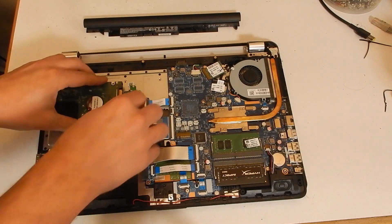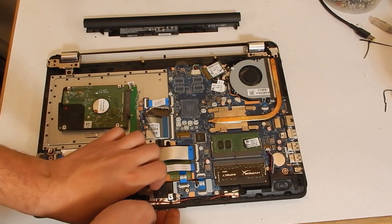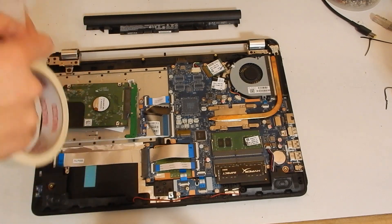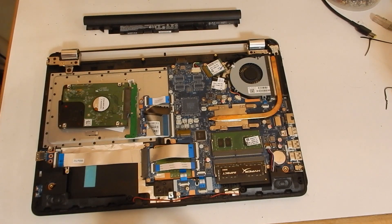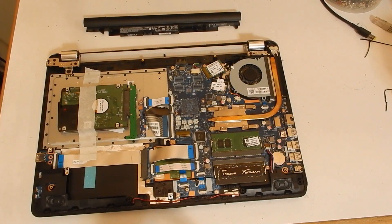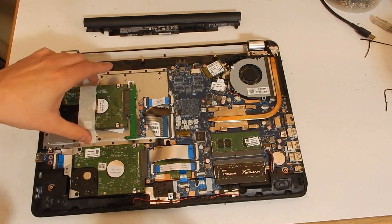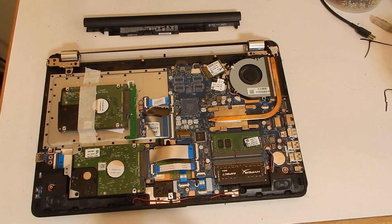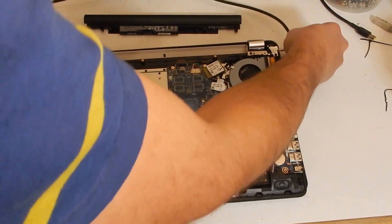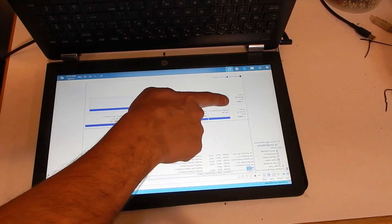Let's test this MacGyvered contraption to see if we can actually use the hard disk plugged into this monstrosity of an adaption circuit. The perfect tool for the job is often the one closest at hand — we use some masking tape to affix the drive in place while we test it. And now we plug in the previous boot drive to see if the system can recognize our MacGyvered adapter. And there we go — the system recognizes the main boot disk as well as the hard disk plugged into the virtual CD-ROM bay. Excellent.